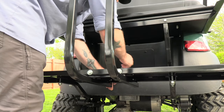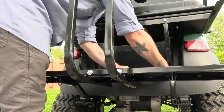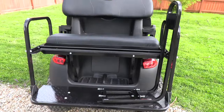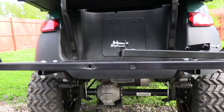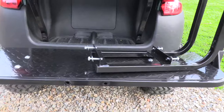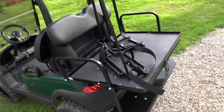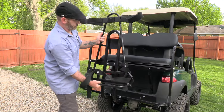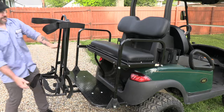The bag attachment we're installing today is only for Redhawk or Rocks rear seat kits that have a safety grab bar no wider than 13.5 inches. As you can see from the up-close look at the safety bar, the attachment points are welded in place and very specific to the mount holes on the underside of the foot plate for this brand of rear seat kit. The bag attachment has two brackets on the rear side that slide right over that safety bar, with a metal support at the bottom to hold the bags up and adjustable straps to keep them locked in place.